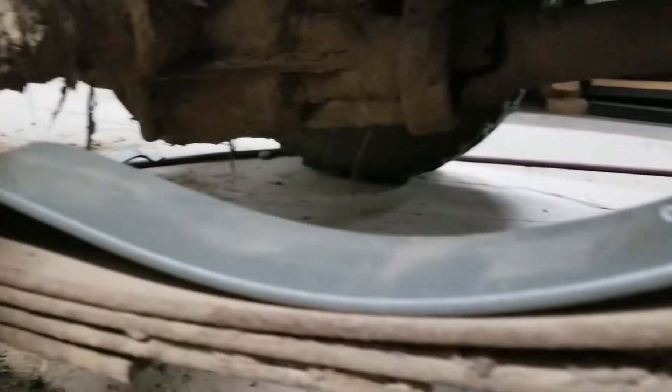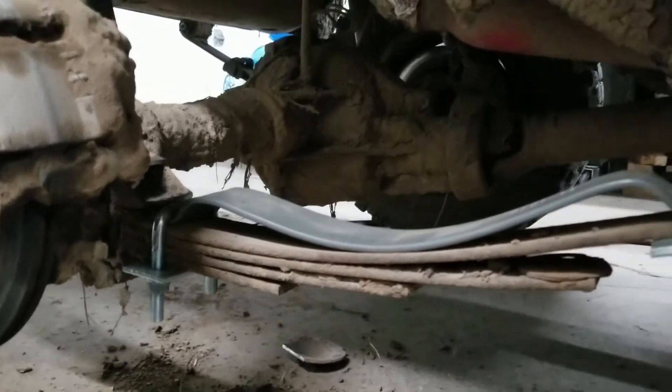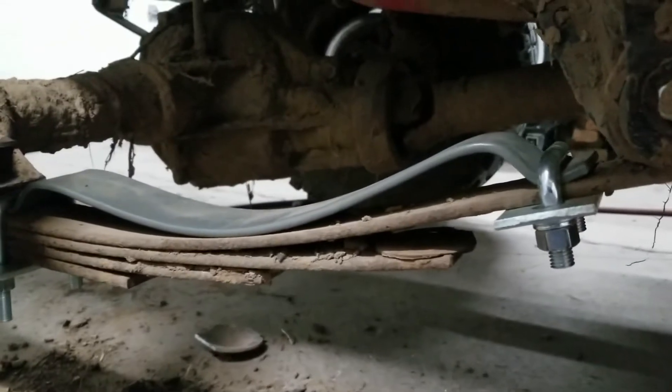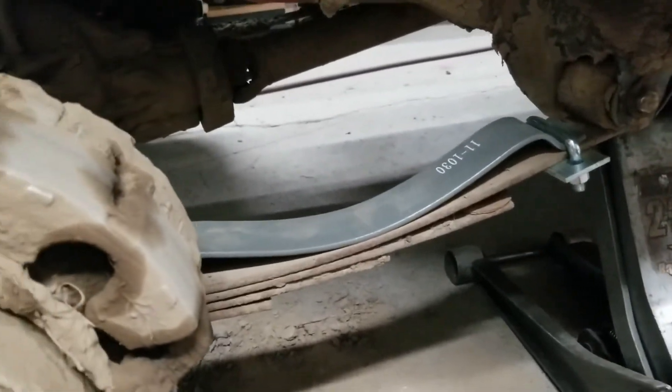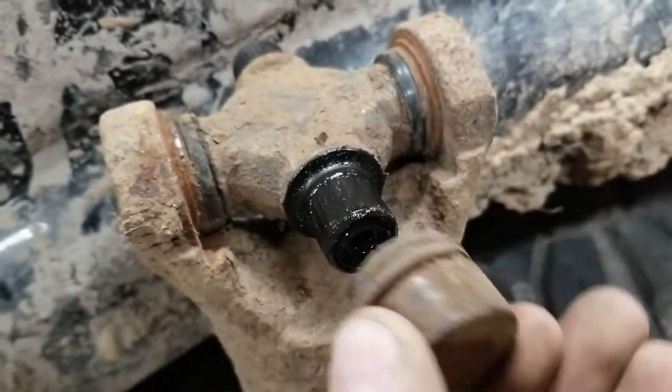This thing didn't fit with the balls in the front or the back, but a little bit of work with the angle grinder and that will be good — we don't need bump stops now, it's mint. If I'm remembering my leaf spring geometry correctly — it's been a while since the Camaro ran, like nine years — more spring rate in the front of the leaf spring than the rear is supposed to help with axle wrap. This thing wheel hops like crazy, so maybe it won't anymore. Perfect, just like I calculated or something.